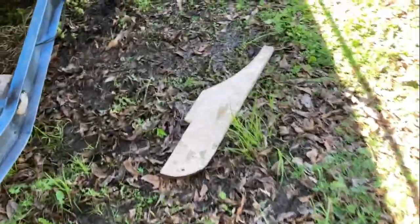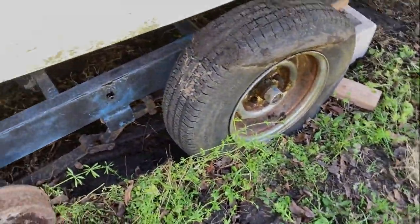I'm now finishing getting this side jacked up to get the fourth wheel off. Finally got the wheels off the trailer. As I jacked up one side and got the tires off, I put blocks under the frame — then as I jacked the other side, the trailer swung the nose around about a foot because it wasn't on level ground. The post that the bow point goes into is now bent about 35 degrees, so I've got to find some oxy-acetylene kit, heat it to cherry red, and bend it back into place.